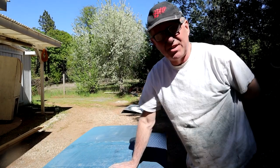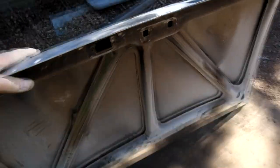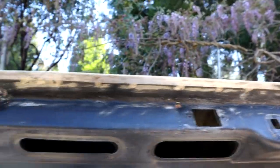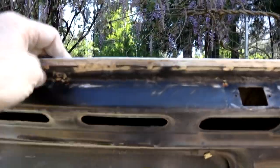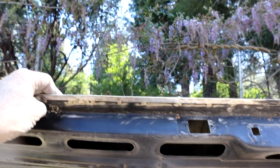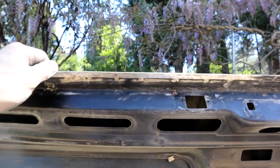After all that, I got a large amount of the hood and rear trunk lid stripped, and I flipped it over and found something. On this edge, someone's done some brazing — a series of spot brazing all the way along — and it's warped the panel a little bit. It could probably be corrected, but those brazing marks and welds I don't really care for. I don't know what's gone on — whether they re-skinned the hood or something.